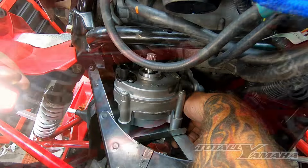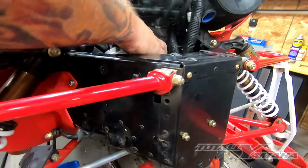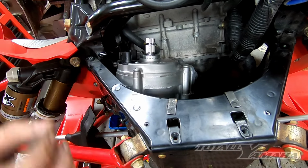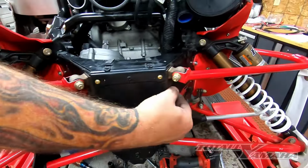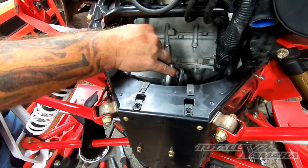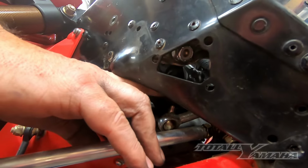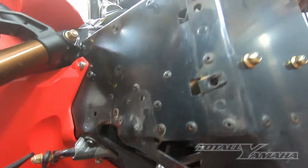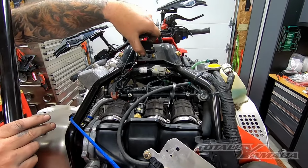Okay, all of my 4 screws are tightened on the main EPS system. Make sure those are tight before you get all these main chassis screws in part way. About 3/4 good threads. Make sure you just get your nut started down on the bottom of the bell crank before you hook up your skis. We'll hook up the ski ball joint once we get the shaft in. And you're going to take the shaft. Here's the new stopper. That slides right on.